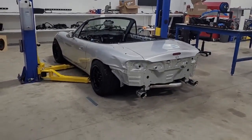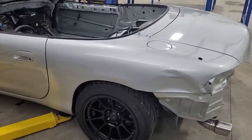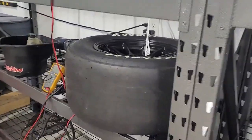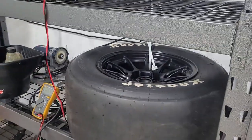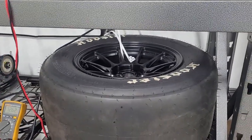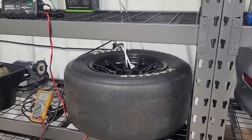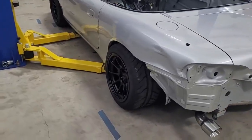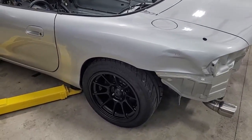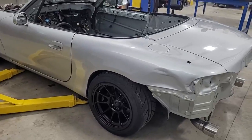Right now with these street tires it's going to look a little weird when we get the fenders on, because these are only 24 inches tall. Eventually we're going to get a bigger tire for street driving since these are slicks - there's absolutely no tread, great for the drag strip but not for the street. This car has been famous for compromises - good for dual duty street and track but bad for putting down numbers. So we have dedicated Hoosiers for the track, but that means we need dedicated street tires. When we get bigger tires and fender flares, we may need to go to 16-inch wheels to find a suitable tire option.